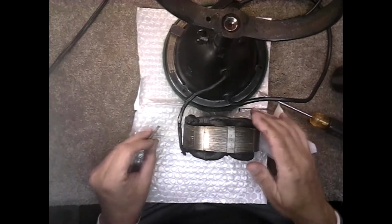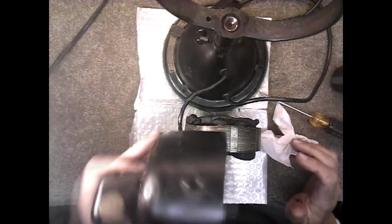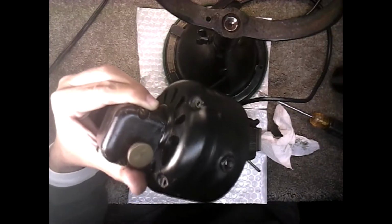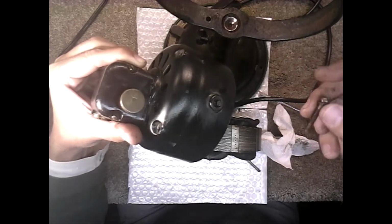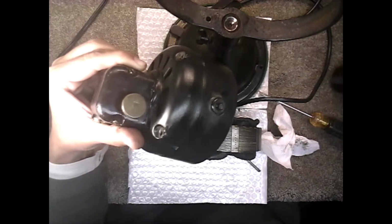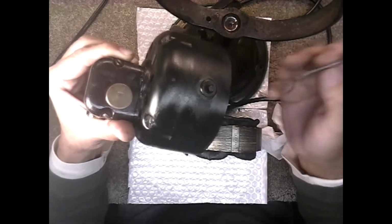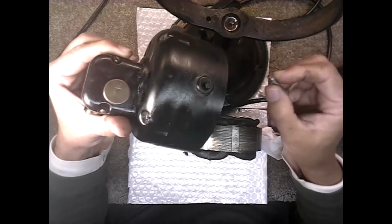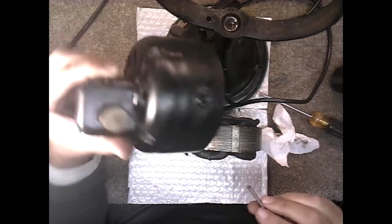The way to get these out of the case, out of the housing, especially if they have screw holes in the back like this one did, you don't want to use the existing screws. Somebody had banged on them once because they're brass and they will bend, they will smash. You get a stainless bolt, but you got to make sure it's the same size diameter and that it is machine thread, because you don't want to put anything in there that's not machine thread.